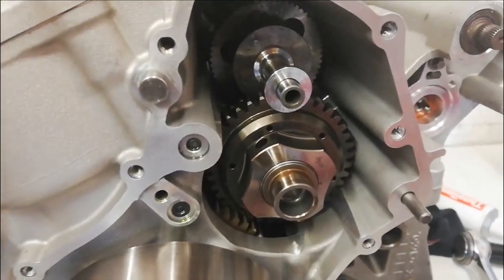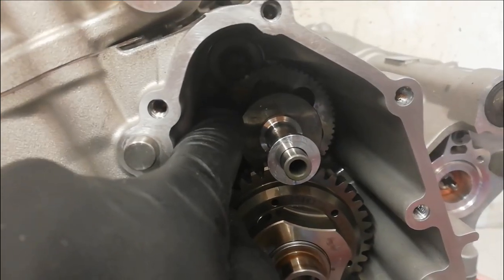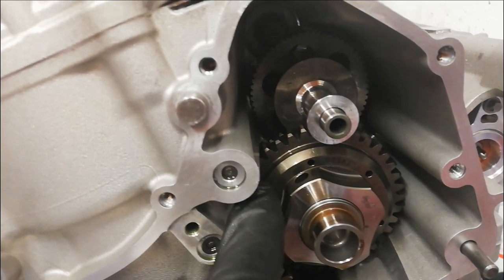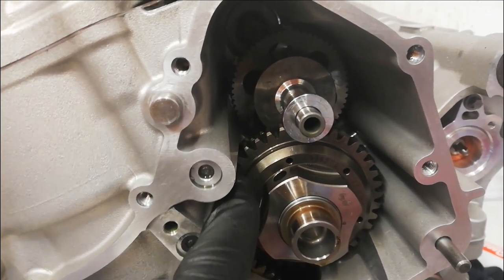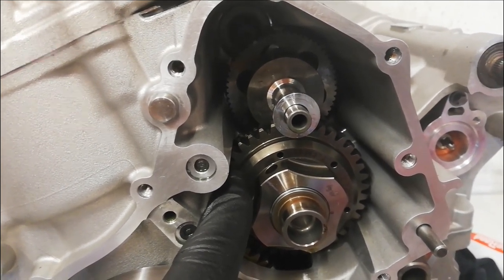As you can see in here, the gears are refitted — it goes from the starter motor just up here in the dark, onto the big wheel of the reduction gear. That's got a smaller gear behind this washer which drives onto the back of the sprag clutch. The sprag clutch is like a one-way clutch — it'll only rotate the engine one way, so when the engine's running the sprag clutch won't engage and everything just freewheels.